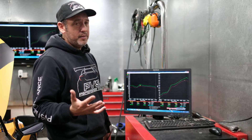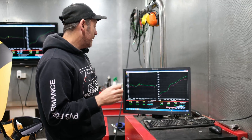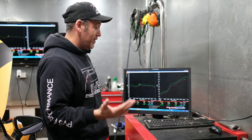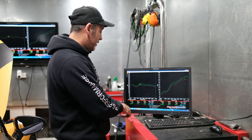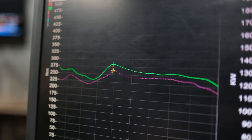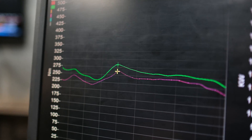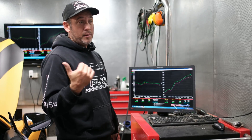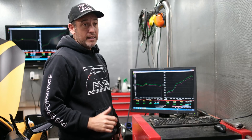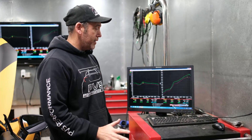Very similar results to what we saw with the two-litre — everything's just up that 10 to 15 kilowatts right through the rev range. On this particular one we ended up getting 176kW at the hubs and 282 Newton metres of torque, which is heaps. This is probably the highest E85 result we've had on here — actually more power than when I did some track days late last year in our BRZ before I turboed it. This thing should go really well.